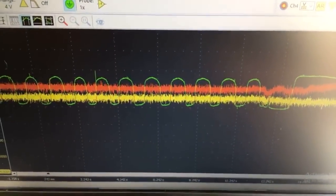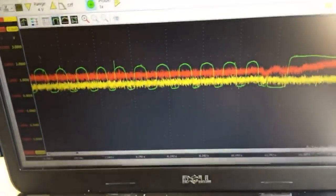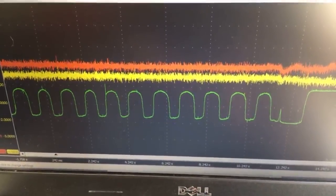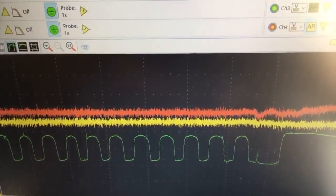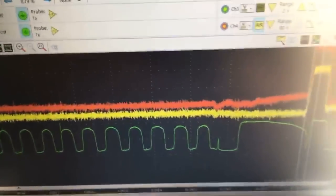If you look at the difference in the clarity on the signals - let's pull the green one down out of the way so you can see it - look at the clarity on the O2 sensor signal which is connected differentially, and then the other two sensors which are connected reference to battery ground. There's a considerable difference.